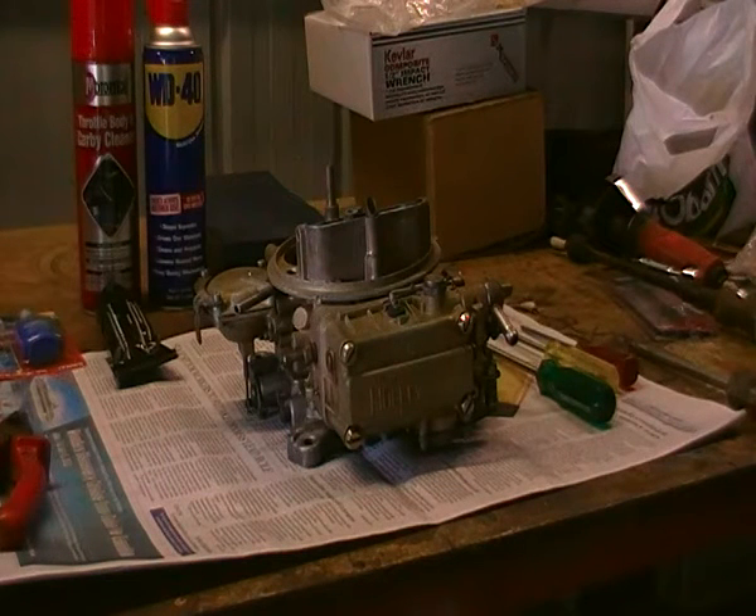Hello. Those of you that have been following my blog RestoCAD60 Plus will have seen some references made to a Mazda 3500 bus. This bus has got a Windsor 5 litre motor fitted in place of the 4-cylinder diesel, but the Holley carburetor on it currently is at 750 cubic feet a minute and it's too big for the job.